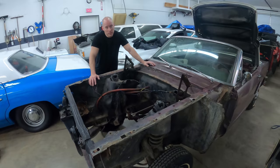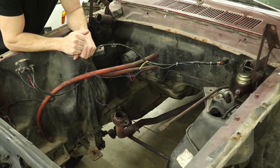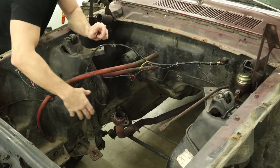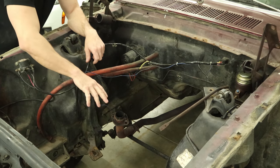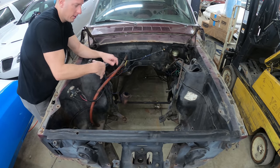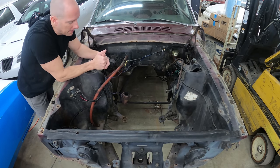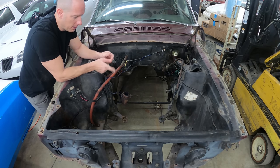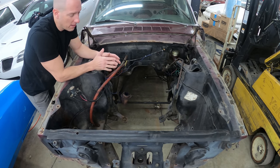Not a big deal — there's other ways around it. Which brings us to plan B, which is pretty simple. It's just a kit. It comes with these frame rails, strut towers, and a cross member. The suspension will then be coil over. We can get rid of all this and have plenty of room for our Coyote. Unfortunately, what the kit doesn't come with is a rack and pinion, suspension, and a few other little odds and ends.